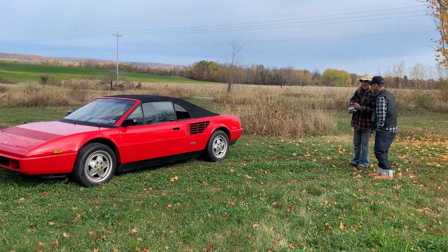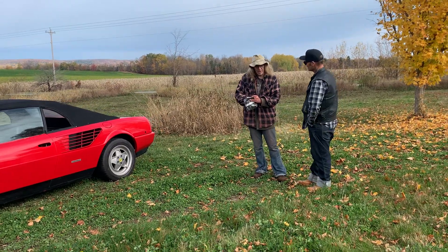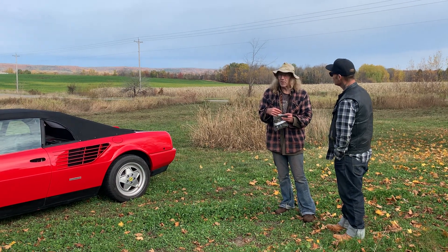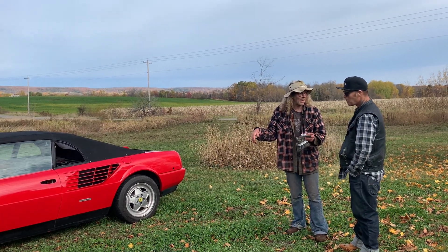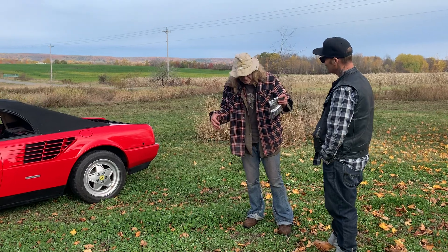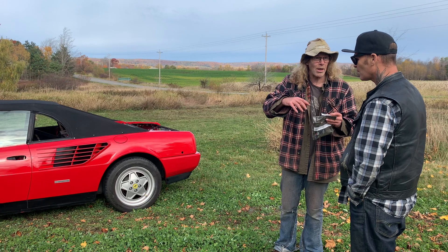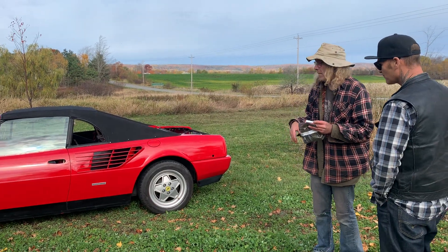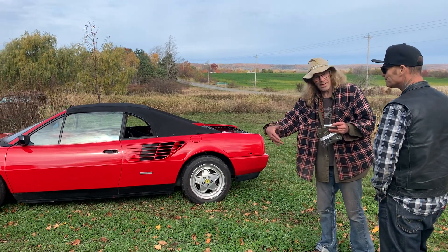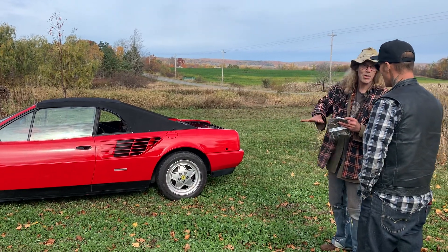I was in bed at 10 o'clock at night when I knew I had chipped the hood and scraped it, and at 11:30 I got dressed and came back out and spent three hours sanding the edge of the hood. I went to bed at 3:30 in the morning, then came out the next day and finished it off. I spent hours masking all around so it wouldn't get overspray on the radiator, the headlights and stuff, because I had to paint it with the hood open and closed — the hood open is where you get the edge inside, and hood closed is where you get the front.